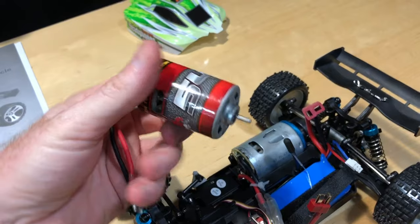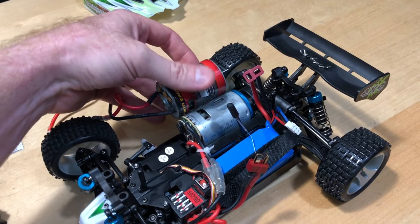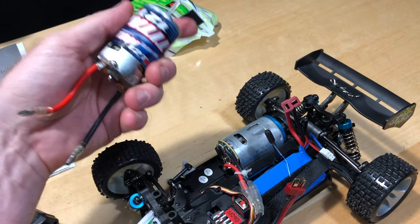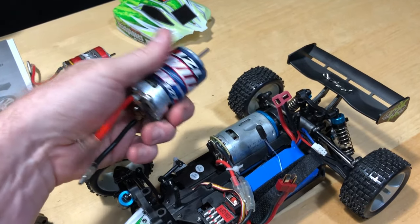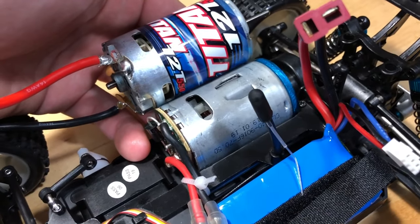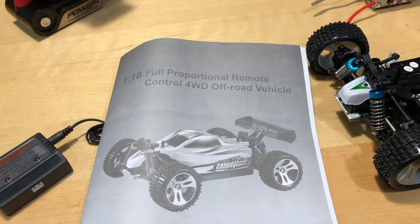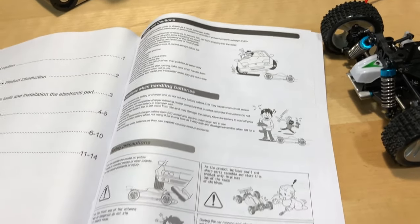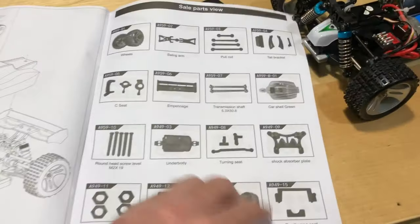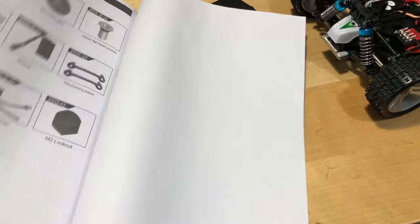This 540 motor is a big motor for this car — that's a big reason I went with it. Here's a Redcat motor, like from the Lightning Drift — also a 540. And here's a Traxxas motor, which comes with pretty much all their brushed systems: the Rustler, Slash, Bandit — those come with the Titan 12-turn motor, which is a 550. You can see there's just a slight difference in the length of the can between the 540 and 550, not much at all, so the 550 could actually fit in here. The kit also includes an exploded-view manual, which is nice — so if you're looking for parts you can check part numbers there.